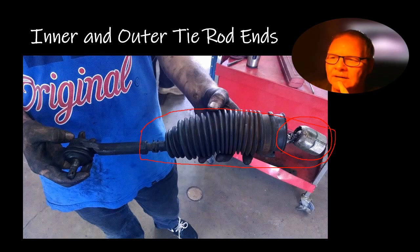In this case we pulled the tie rod out to replace it. It will come with the assembly and you have to screw it in. Typically you can count the turns when screwing tie rods off — usually about 20 or 21 turns — but you're still going to have to adjust the toe after replacing the tie rod. You can't claim alignment will be exactly right even if you counted the turns.